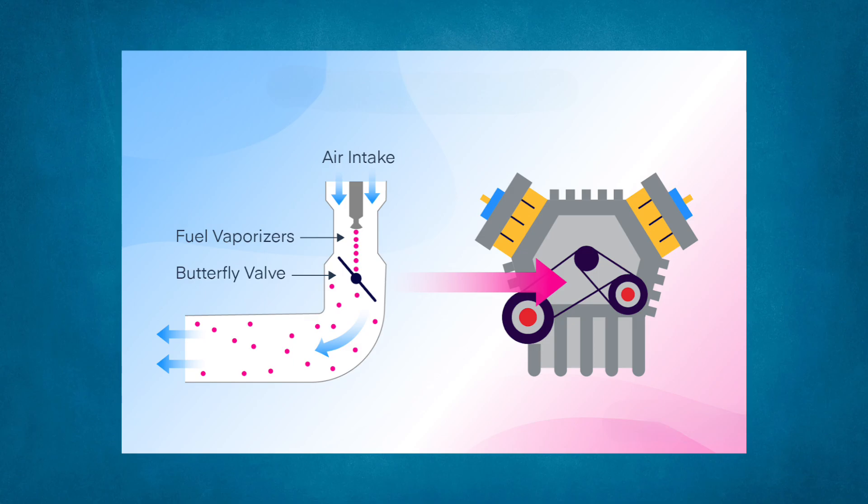The rate at which the air is drawn through the carburetor is controlled by a hinged valve called a butterfly valve. This butterfly valve is directly linked to your throttle controls. Full throttle means the butterfly valve is fully open. With the throttle back at idle, the butterfly valve is nearly closed.